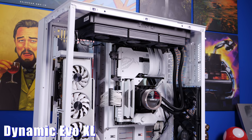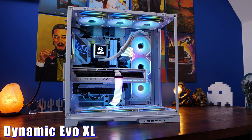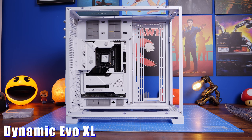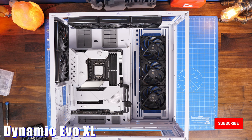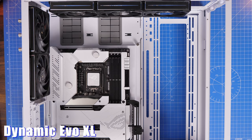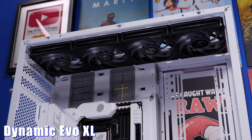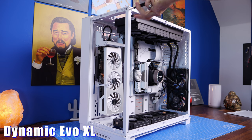Perhaps too spacious — some have commented that it looks empty with certain setups, so something to bear in mind. The Evo XL allows you to mount your motherboard in top, middle or bottom positions. With an ATX board in the bottom position, you could put two 120mm fans at the rear and still have plenty of room at the top, or alternatively mount four 120mm fans on the top, which isn't listed in the specs but is possible.